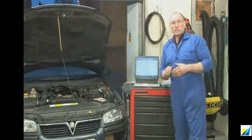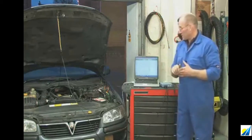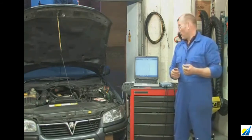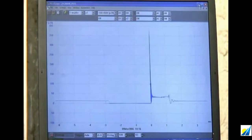The two connections I've ensured are correct: battery negative for the reference lead. This type of vehicle has a double-ended coil principle where a four-cylinder engine has two independent coils — we are in one coil winding only, so we're looking at a pair of cylinders. Press the space bar and we now have an extremely accurate rendition of the waveform in one of those coil primaries. From this signal we can refer back to the help page to interrogate and understand all the composite components of that image.